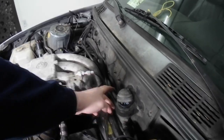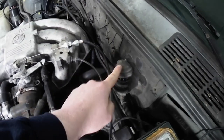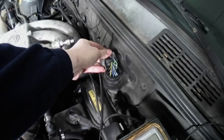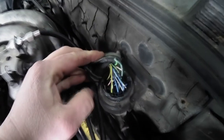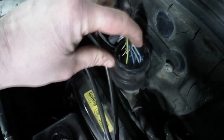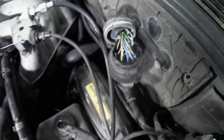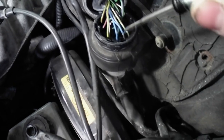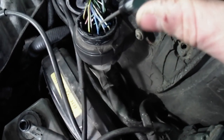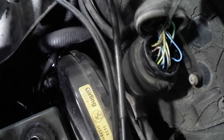This is a C101 connector. It's coming to the fuse box. And then this end is going back to the engine harness. Okay. I have mine peeled back because I was, again, probing stuff and showing things off. There are labels on the connector. Pin 7, which is, we can dig away with this a little bit. Pin 7 is right, I think, here. This one right back there, that big green one.